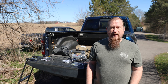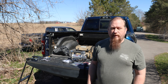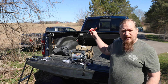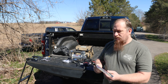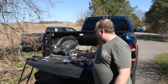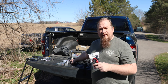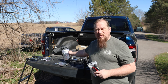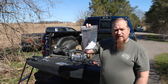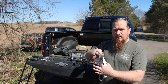Today I'm going to show you how to do a quick and easy upgrade on a 12-volt portable air compressor. We're going to remove the alligator clips that it came with, install this SAE connector on there, and that will allow us to choose between either running the alligator clips to the battery, which is a little inconvenient, or a much more convenient option, this 7-pin connector, so I can just plug it in at the rear of the truck here.